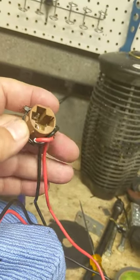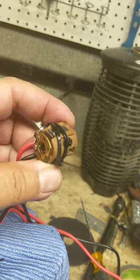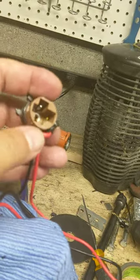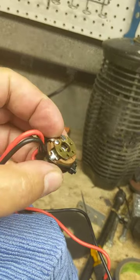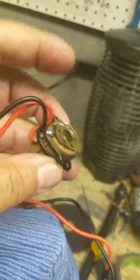This is the original plug for your socket — and I know that looks crappy, but it'll be hidden behind your shifter bezel so relax. From a mechanical standpoint, some cable ties and some solder are all you need. The 12-volt lead goes to this blade here.